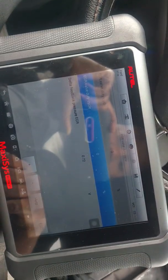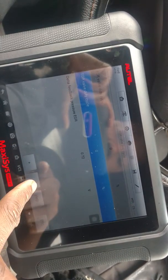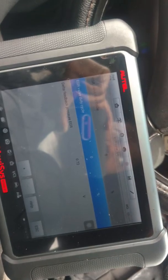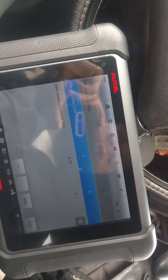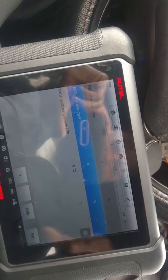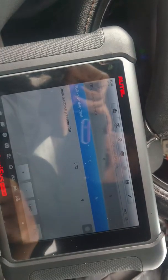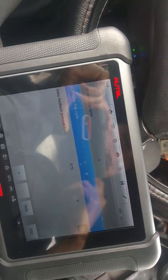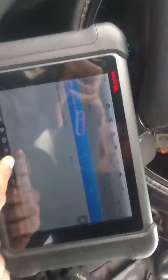I'm going to command the EVR to basically shut off the bleed and create a vacuum so that the EGR can be actuated. I should see a really rough idle, and this voltage of 0.72 volts should rise up close to five. If it doesn't, then according to what I understand from scanner danner, I have clogged ports.